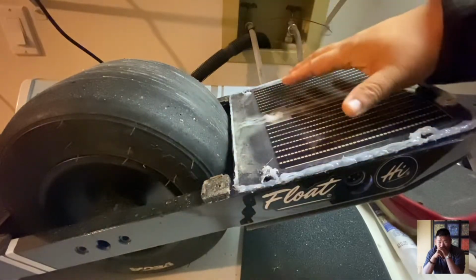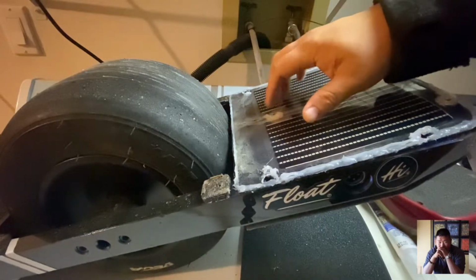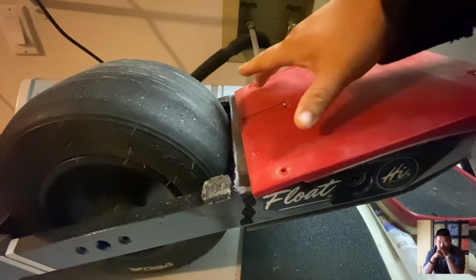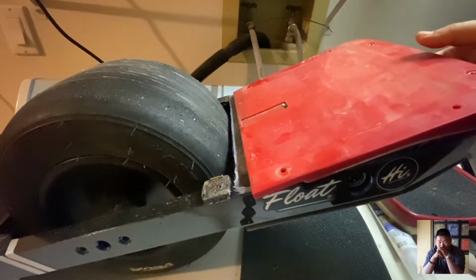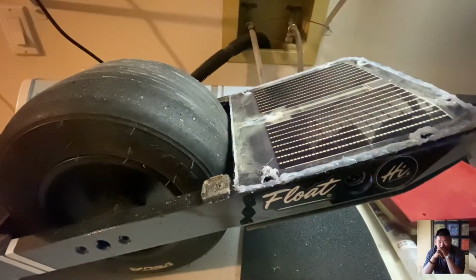And then it's just a matter of sticking it on the shiny side of Kydex, after you've drilled out your holes first and cut out a notch for running the cable. An alternative, which locks you in to one foot pad, is putting the sensor right down onto the bottom of the Kush. You can do it. I don't think it's as responsive, but I never fully mounted it up, so it may actually work for you. Then all you're going to do is put a bead of silicone or tape just around the edges again for waterproofing, and you should be fine.